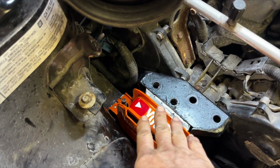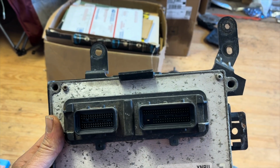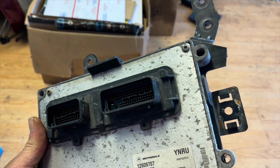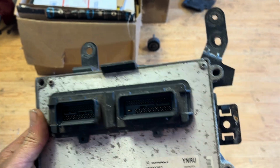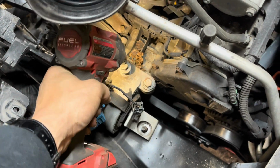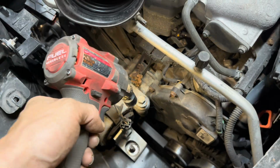And if you're using one of the Clayway Ultimate brackets, you're going to want to remove this whole bracket. This is secured down by 3 10 millimeter bolts. One here, one here, one here. You can get them with the 1/4 inch socket, deep well 10 millimeter, and take them off even in the blind, meaning you won't be able to see this one right here. Motor moves down just a hair, but it's okay.